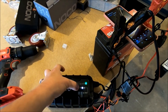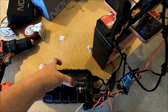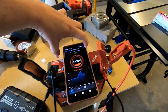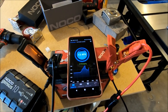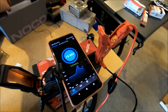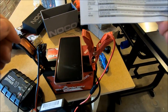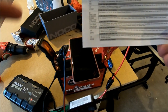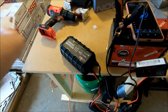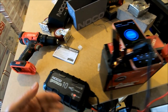To access the additional modes like repair, instead of a quick press you do a press and hold. That brings up options: 6 volt, 6 volt AGM, and 12 volt supply. Let's check out the 12 volt supply mode — it looks like it runs at about 13.5 volts, same as the other models. The Genius 10 actually does 10 amps supply at 13 volts. I might do a load test to verify that, but it's a really cool feature — you could basically plug this in and run your radio all day long with it supplying 10 amps.